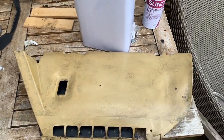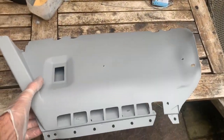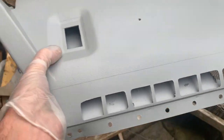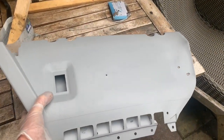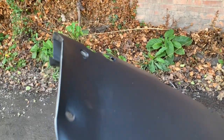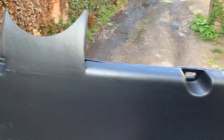Next job is to put the coat of adhesion on, let that dry, then the primer, then the black. We've left this overnight now in primer — we put on two coats of the plastic adhesion promoter and about three coats of primer. We're now going to spray this with a special black plastic paint. With the proper primer and the proper paint, that's come out really nice and it's ready to go back in.